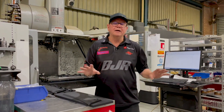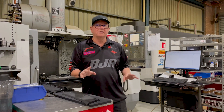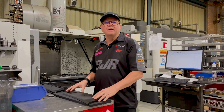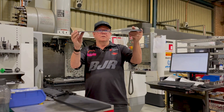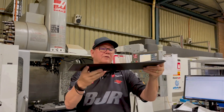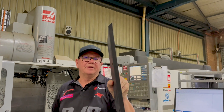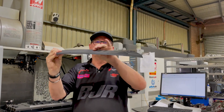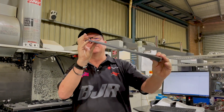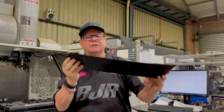On the front under tray, which is the same for the Mustang and the Camaro, they've changed the shape of the skid plates so it's got this smaller area at the center of the front. This is what they look like last year — you can see how thick that is, it's about 15mm. This one has got the end tapered down and the center section is going to be less than 5mm, or around 5mm thick.